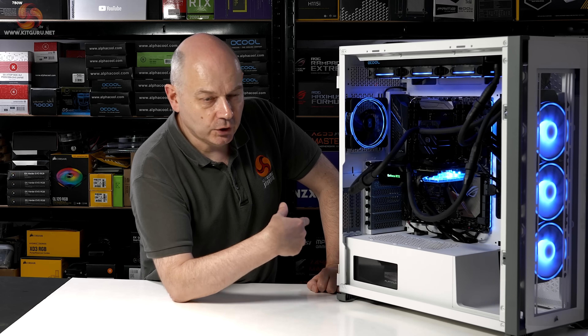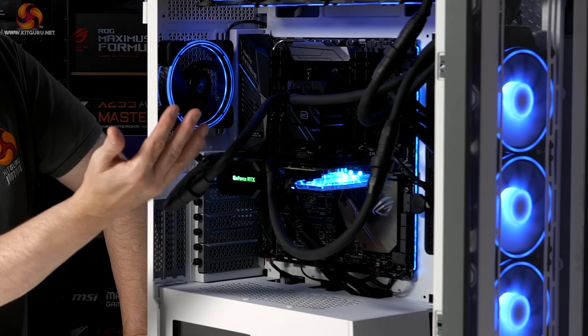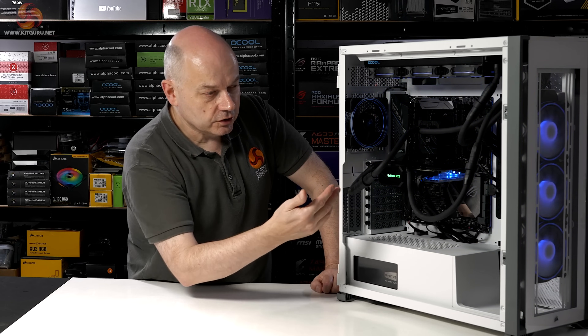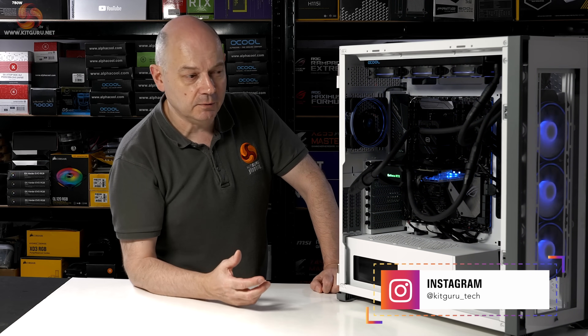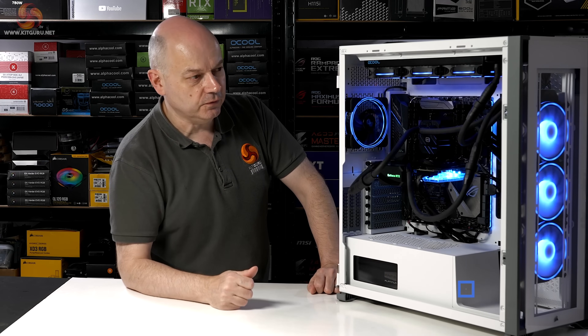The build is complete. This is a sponsored build rather than a review, so I don't have to offer any particular views — but I'll offer two. One: the hoses are very long, this is a huge case, and yet just look at it. A smaller case could be problematic. The other thing: this is a GeForce RTX block, so you get green writing on the pump whereas everything else is RGB on breathing blue — a bit of a visual clash. On the other hand, were we to fix the PCIe Gen 4 riser problem and use a vertical GPU mount, it might be a completely different story — the hoses would go different places. Food for thought. Job done.